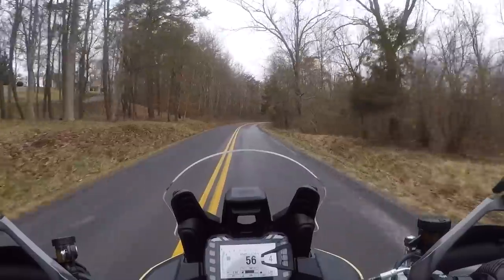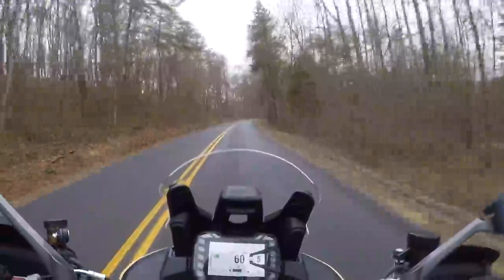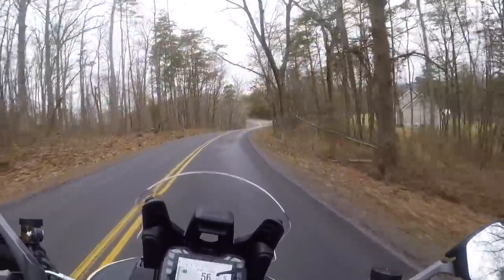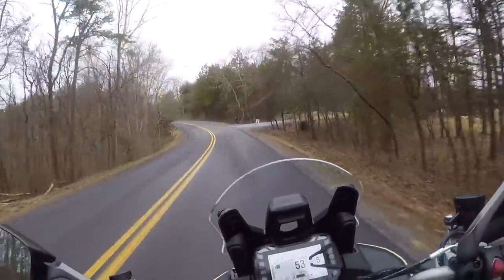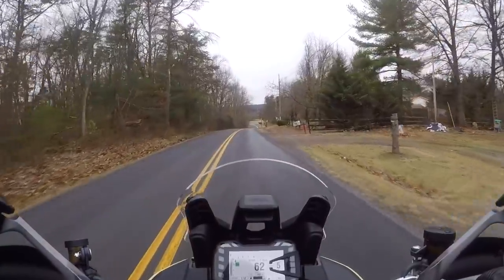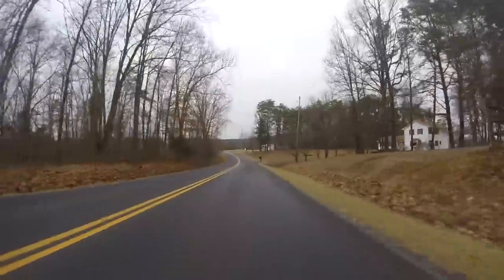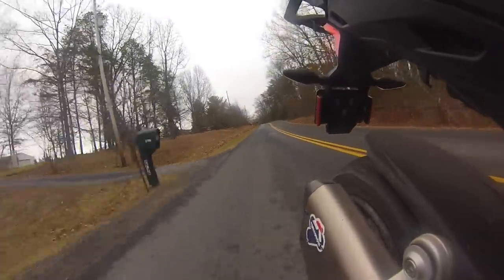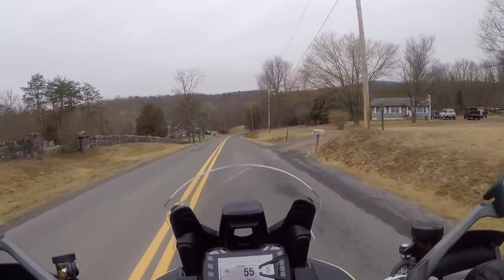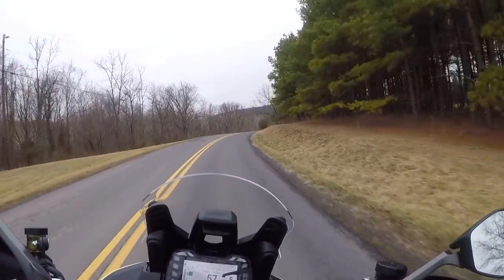There is a big difference between touring mode and sport mode — not just in fuel mapping but in suspension settings. I was riding down a beat-up back road and switched from sport mode to touring mode. Sport mode was beating me up because the suspension was much harder. Switching to touring mode I was able to keep going at a much higher speed as it soaked up the bumps. So there is a very noticeable difference between the suspension settings.